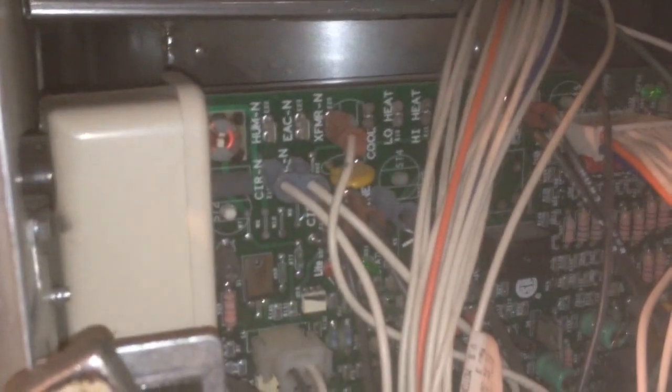It's pins 1 and 3 to common, and 12 and 15 to R. Once you get the motor out, you want to ohm out the motor to make sure it's not the problem — just to verify. But she's up and back running. Take care, guys.